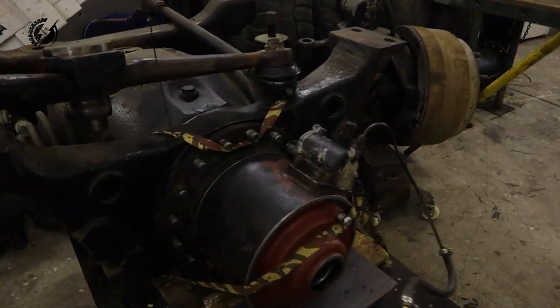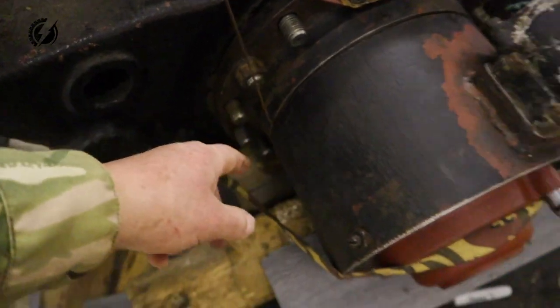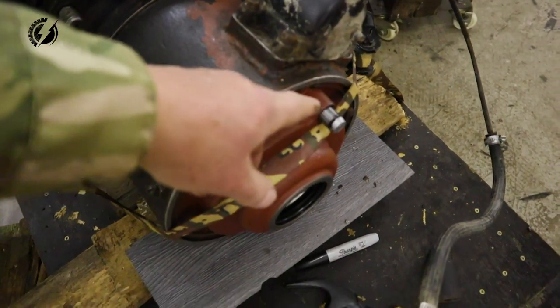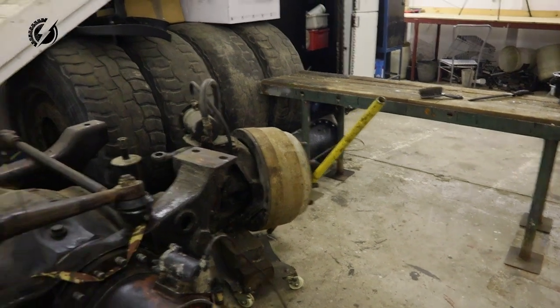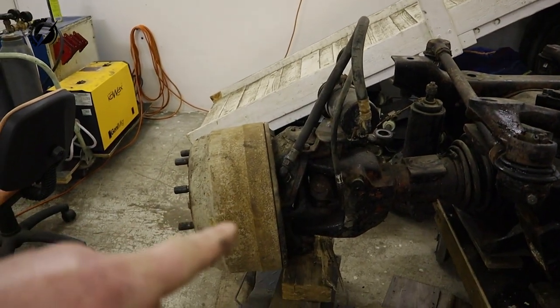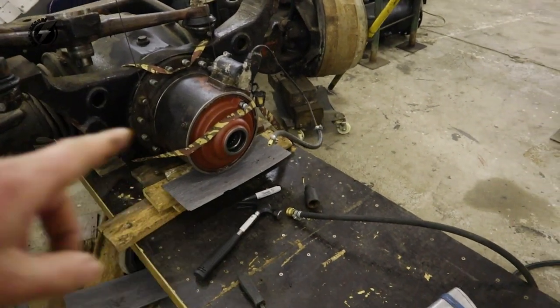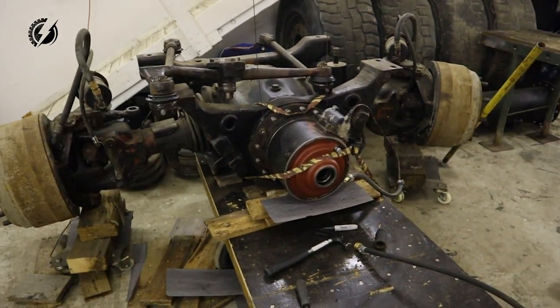Check this out guys, I have it ready for the test. I have it in position, 2mm gap over here by these wires, everything is hooked. It's in open position, so when that wheel is blocked this one should spin. After I lock it with the air, both wheels are supposed to be locked — so we'll see.